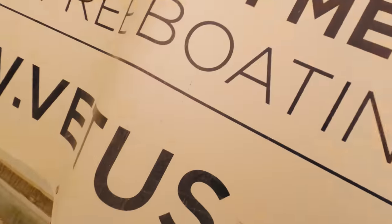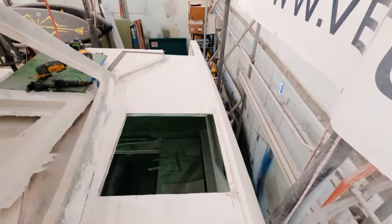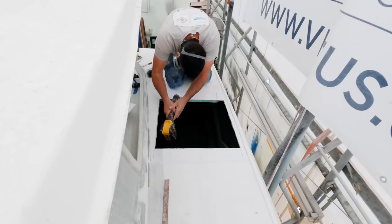We got a lot of rigidity in that, and we're going to do the same thing we've been doing on all these other areas — glassing from the inside, adding core back, then glassing again over the top of that, so it's incredibly rigid through these areas. Could be unidirectional in there as well. But that is now a big old hole.